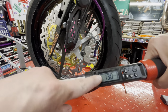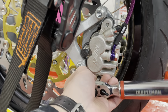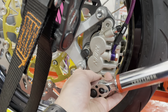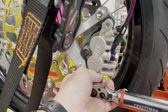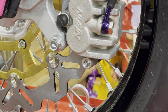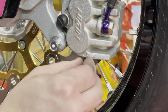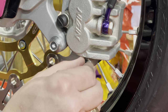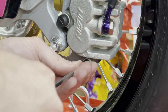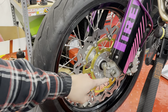And that caliper pad pin is 13 foot-pounds. And that is your 5 millimeter Allen. Take your flathead screwdriver, put our little cap back on. Going to go ahead and torque our front axle pinch bolts down to 13 foot-pounds. That's on both sides.